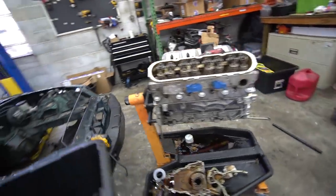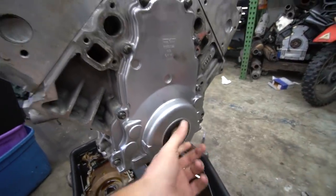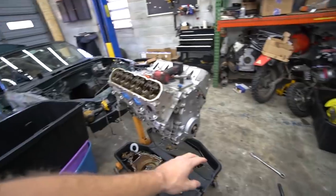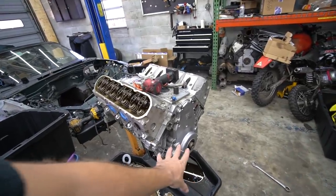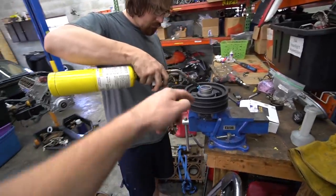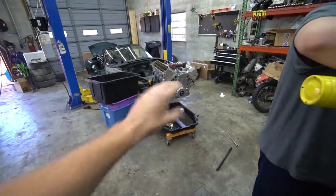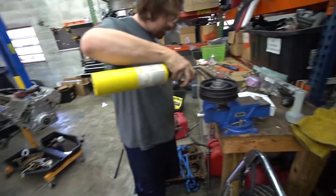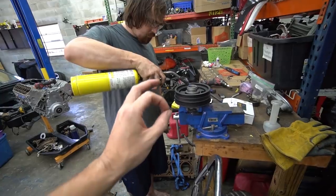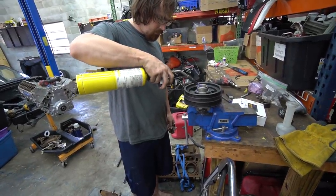Front and rear covers are on. With the front cover, you've got to install it loosely because it is centered by the crank pulley. There is a special expensive tool for pressing the crank pulley on, but there is the simple sloppy mechanics trick — you just heat up the inside to expand it a little bit, pop it on. As soon as it hits the cold crank, it shrinks and it's locked on. The only tricky thing is if you underdo it, you'll end up having to pull it off and heat it up more.